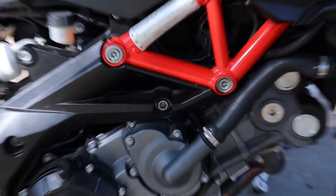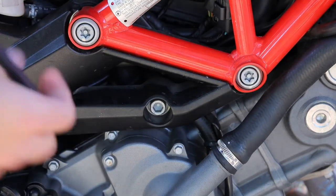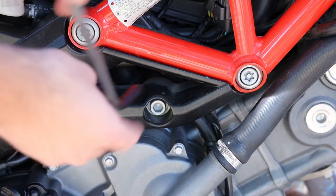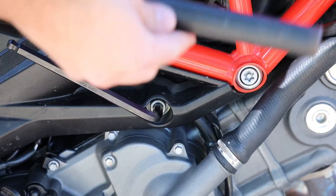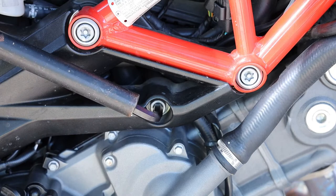And here's the right-hand side. Right here is where you have your 10 millimeter part. That's what I was saying — it's better if you have a socket that has the hex key built in. I don't have one that fits, but I do have a 10 millimeter Allen key wrench, so I'm gonna be using that. If you can't get enough leverage, it's always good to have a breaker bar so you can slide it over and get more leverage.